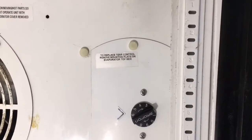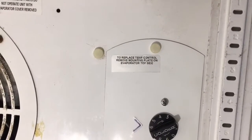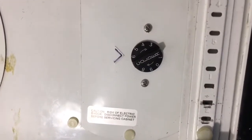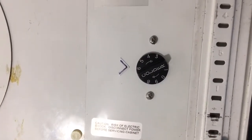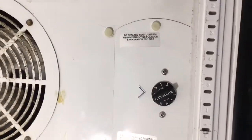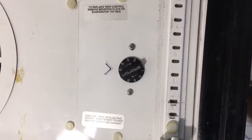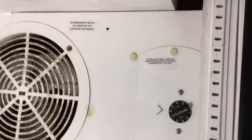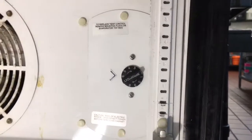And there it is, put back into place — plastic screws top and bottom, new stainless steel screws in the middle. True likes them set at number five — that's their starting point, that's where all the Trues are supposed to be set. I like to put them one more to number six, a little bit colder, so it hopefully impresses the customer. Thanks for watching — click like on the video if you could and subscribe. This is how to replace the temperature control.